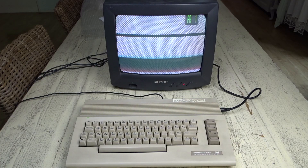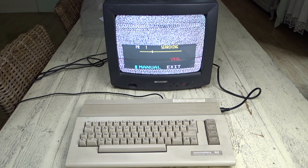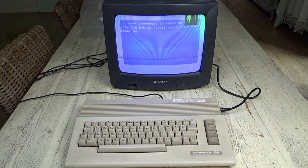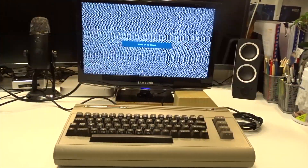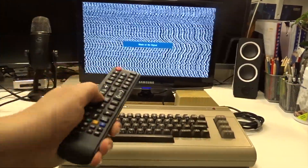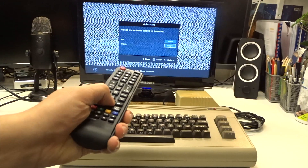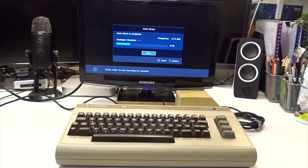The first time doing this I realized that my other computers that used RF were not broken — like the Commodore 64 I showed at the beginning of the video. This will also work with modern televisions that still have an RF jack, like this Samsung monitor slash television I have. On this one you just go to the channel menu, select AUTO SEARCH, select cable, then go to analog, and like the old CRT it will automatically look for all available frequencies and eventually connect to the Commodore 64.